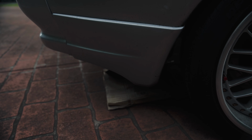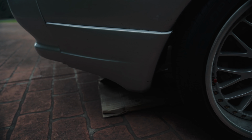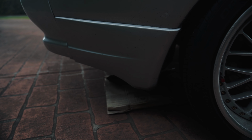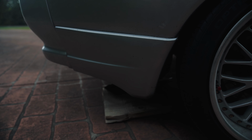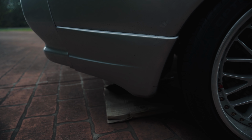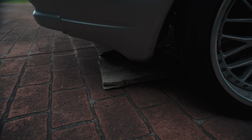respray the car. So another pretty concerning factor is that it's got a fuel leak, but not near the engine bay, right near the fuel filler neck. So that's gonna have to be addressed pretty quickly. So it seems to only leak when it's got more than half a tank. So that leads us to believe that maybe there's just a bit of rust because the GTS-T tanks are metal. So if that is the case, it might genuinely just be easier for me to put a GTR tank in because it's plastic. And then I think from that, I just have to replace the hat for the hanger of the fuel pumps, and that should all still work. I'm still very unsure. I need to do a whole bunch more research on that. But yeah, it's pretty bad, and you can tell that by the permanent residence of cardboard under the fuel tank.